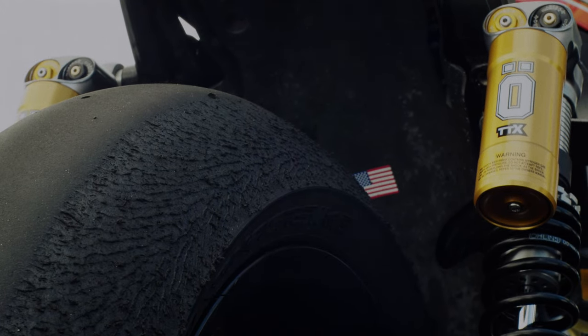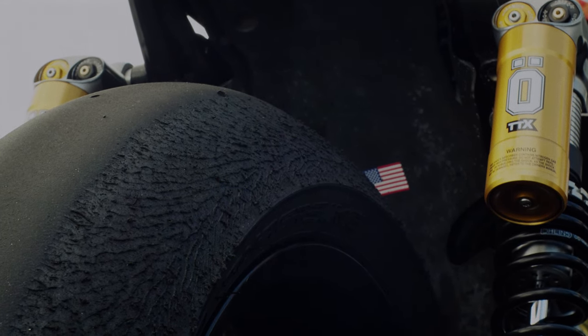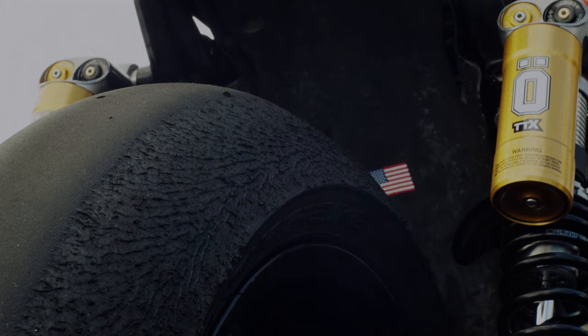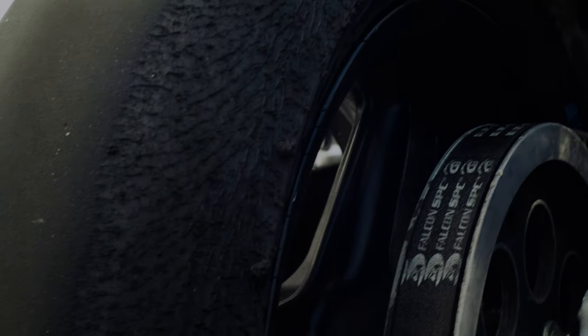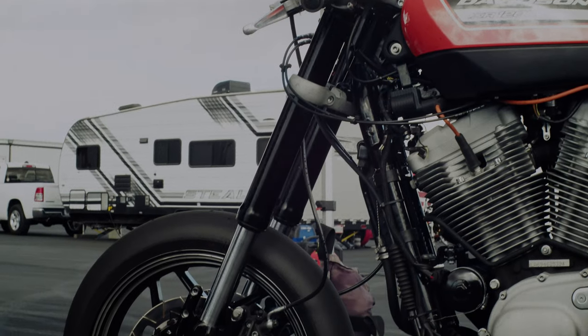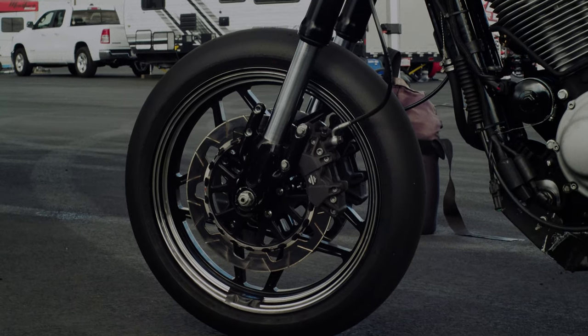You can see the tire wear — we're going clockwise direction today. The truth's in the tire. I'm getting a lot of tire tear because I'm able to pull out of the corner harder on the edge of the tire, and because the tire is not skipping, it's tearing more on the right side because we're in a clockwise direction. Right now because it's new suspension, I never ride anything brand new out of the box more than 80 percent.